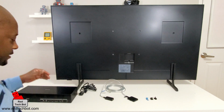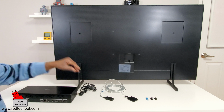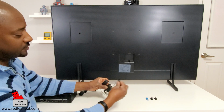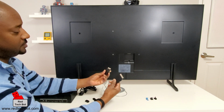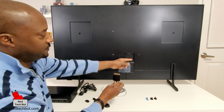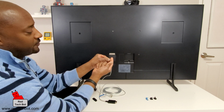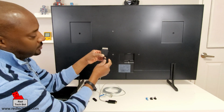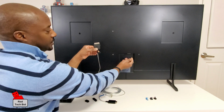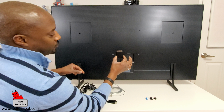Now to connect the Samsung One Connect to the screen assembly, which is this cable, it's very important. You take these covers off the cable, on both ends. The end that says TV connects into the back of the TV, into a connector here. So obviously you want to put it this way with the TV logo facing out, and this attachment goes here to protect the connection, like if you pull this by mistake, you don't want it to damage the connection. So this has to align with that hole, so you know you have the right orientation.